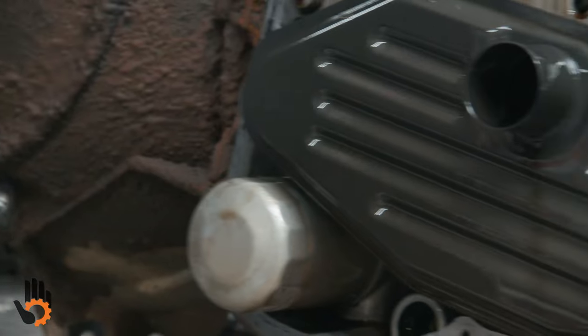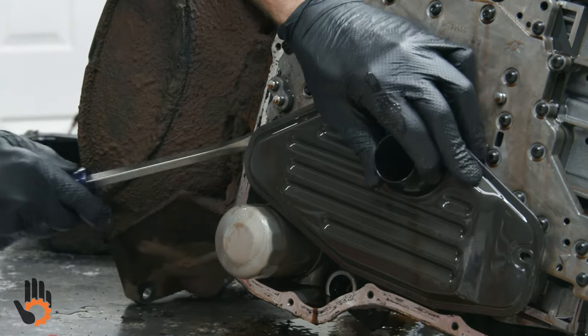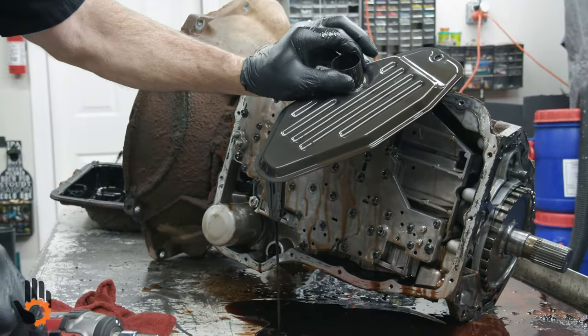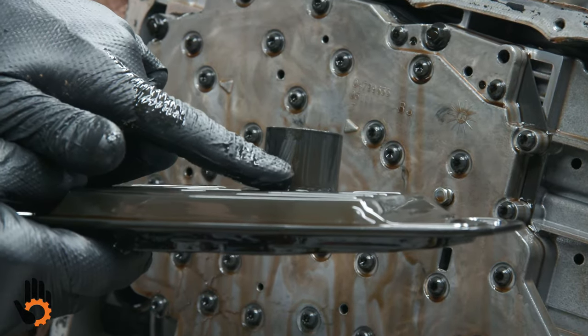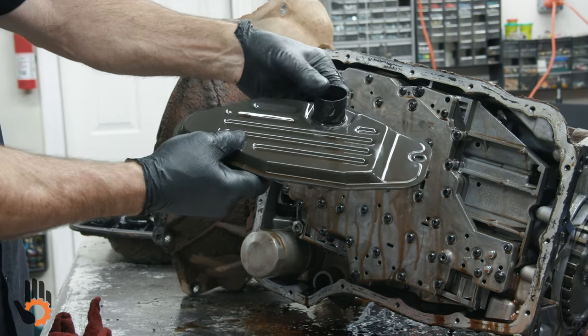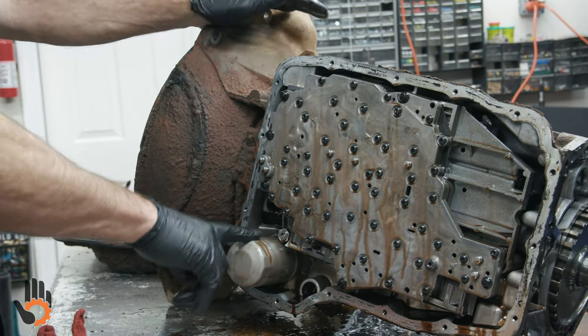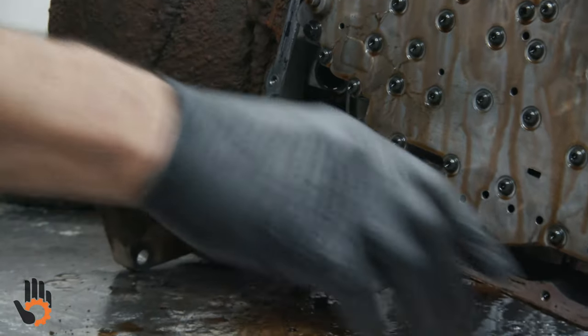One little bolt there for your filter, and then we should be able to pry it out from underneath where it goes into the pump. These filters came in two different heights or depths — one was about half the height with a shallower transmission pan, usually on earlier two-wheel drive units. Most everything later on, plus four-wheel drive, all used the deep filter. The spin-on filter stayed the same no matter what year or unit size.